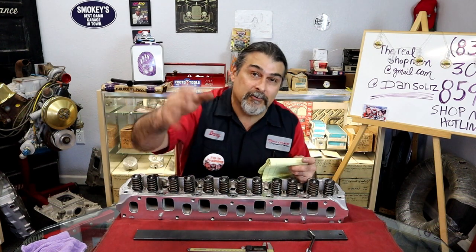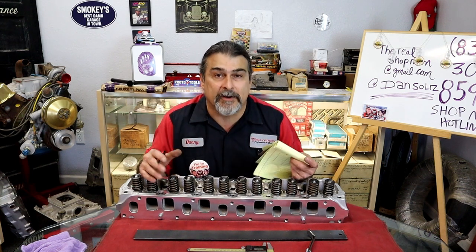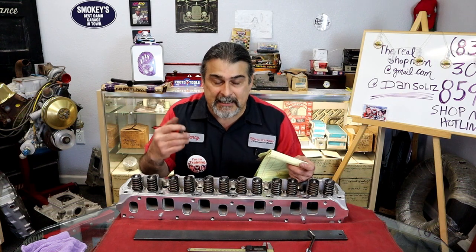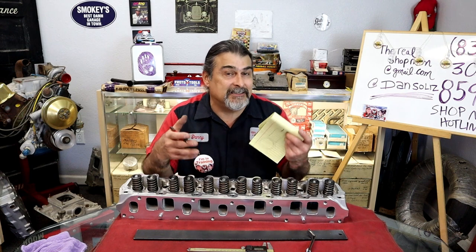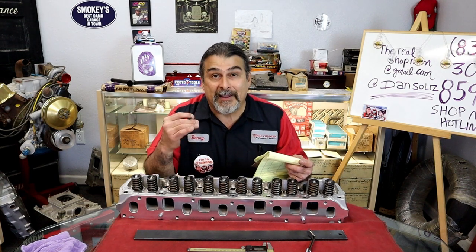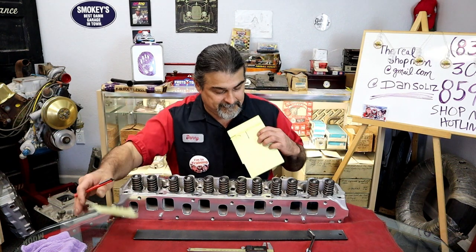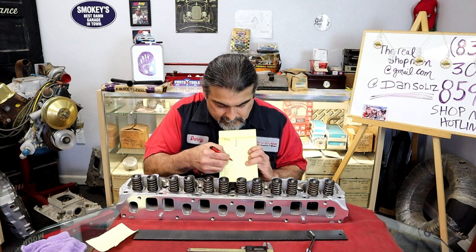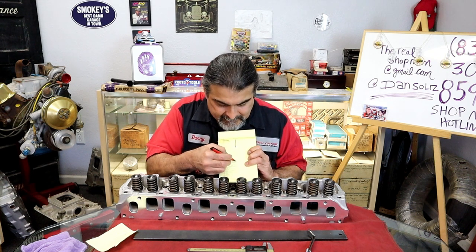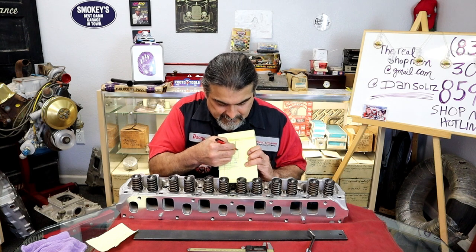All right, so a Johnson lifter. Don't need to stop right now and go Google Johnson Lifter. Johnson Lifter is a hydraulic lifter, one of the best in the industry. Now is Johnson High Lift, but everybody uses the Johnson Lifter style. So a Johnson Lifter has inside of here, it's a bore, a spring, a check valve, and a piston, and a C-clip on the top.